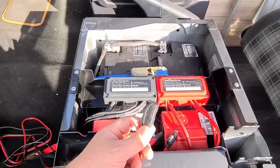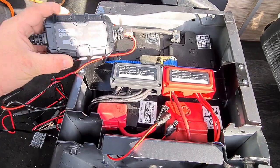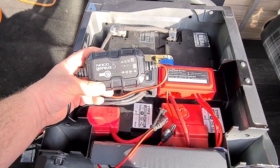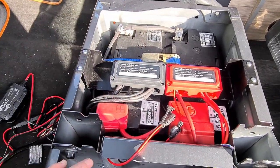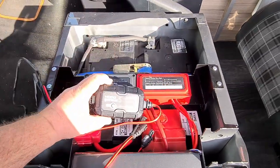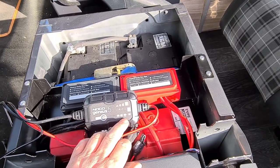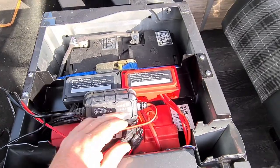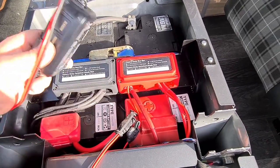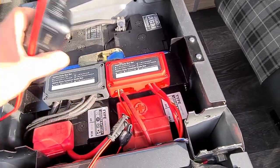Another little addition is this charging point for my battery. When winter comes or I'm on a caravan site with a hookup, I can plug this NoCo Genius 5 in and keep the batteries nicely conditioned along with the solar topping them up through the day. If you want to buy a battery charger, this little thing is awesome. It does lead acid, AGM, lithium, and even six volt. Once it's got your battery up to charge, it starts conditioning it. I think it's about 40 quid — I'll put the link in the description. I love it.